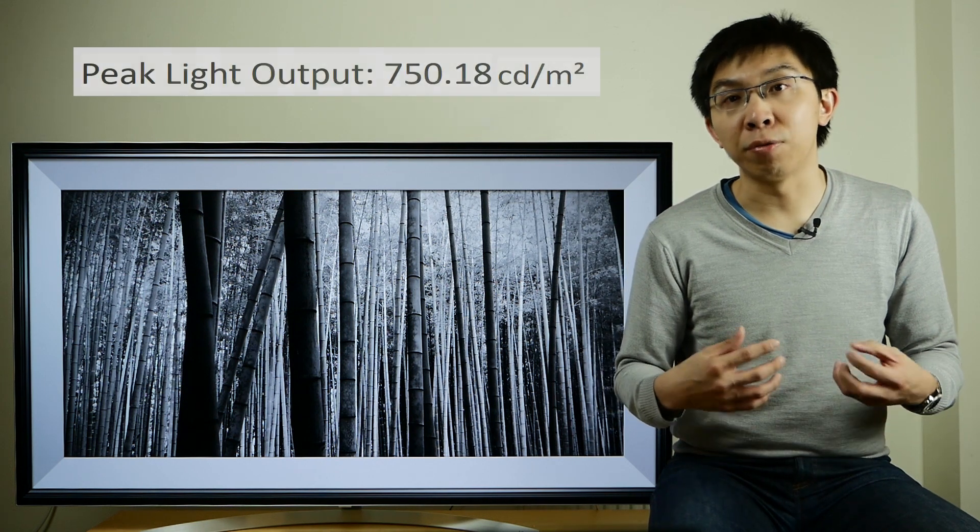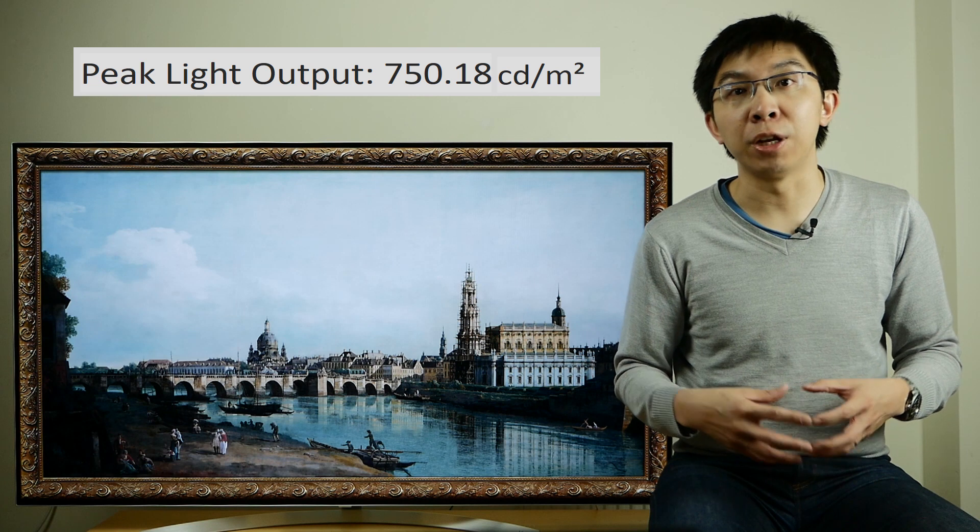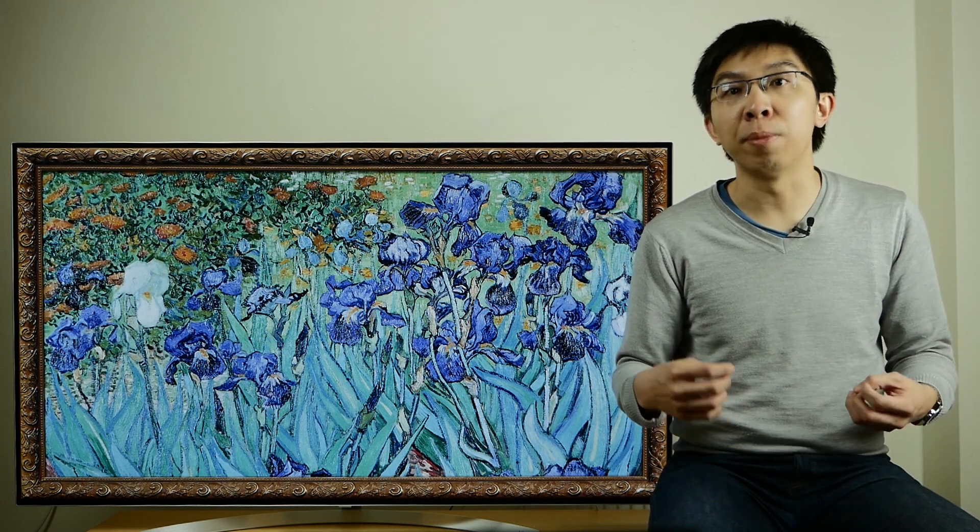On a 10% window with white point calibrated to D65 industry standard, peak brightness measured 750 nits in HDR mode on our OLED 55B7V retail sample. LG has been claiming 1,000 nits at a 2–3% window in HDR Vivid mode, but the highest we could measure from our 55-inch B7V was 880 nits even under those conditions — maybe 1,000 nits is only achievable on 65-inch models or selected panels. LG's tone mapping algorithm tries to retain as much specular highlight detail as possible within the constraints of its 750 nits peak brightness, so the overall image in HDR can look slightly darker, especially on 4K Blu-rays mastered to 4,000 nits. We found it necessary to engage Active HDR, which is LG's technology to simulate dynamic metadata from static metadata, to keep the picture bright enough.